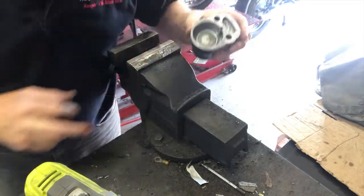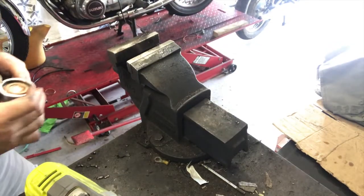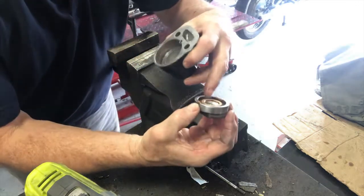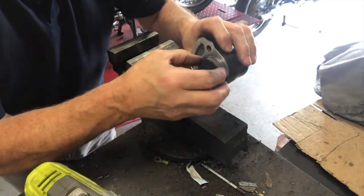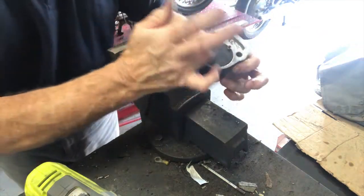And that will just stop the start of any new corrosion. Okay, let's pop our piston in. Once again, there's a tiny smear of copper grease in the back of that. I've put something on that little spacer just to stop it. There we are. That brake should be super now.